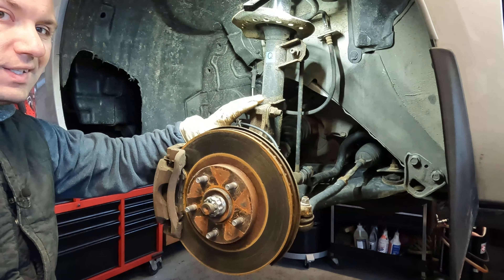We were able to get our control arm off. To give you guys a nice idea, this ball joint is pretty much done for, and this bushing as well. Notice how it just cracked up — all the bushings are pretty much done for. The best example is right back here — look at that cut in there. So that's the reason why we're going to be replacing these.